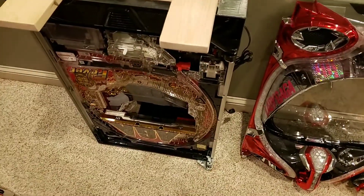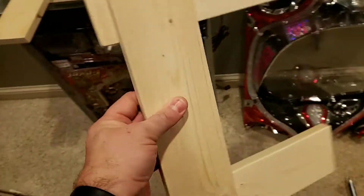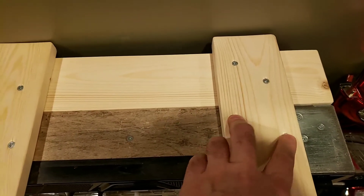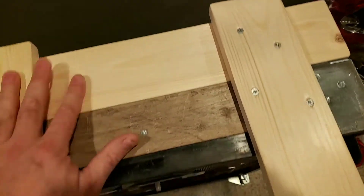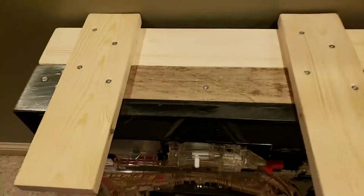When you get your machine, if we've shipped it unassembled, you're essentially going to put the door on the frame and add the feet. You do need a drill and that's about it. You'll get your feet already pre-assembled, you just have to screw them on. There'll be a bag of screws — you need two screws in the pre-drilled holes. Screw them into the base, flip your machine over, because the straight board is on the rear of the machine and the feet just flop on top. Stick that on there, put four screws in, then rotate your machine back over.